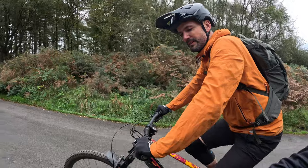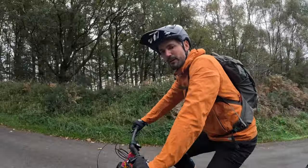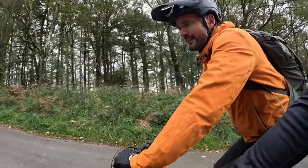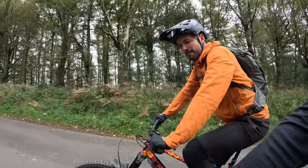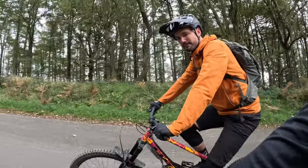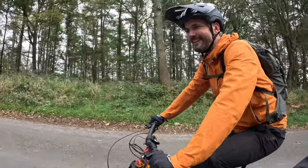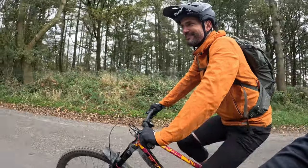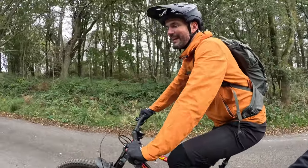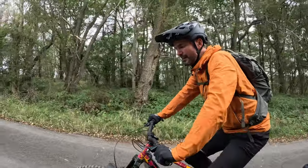That's the stock setting, but we can still do our mullet setup the way we do on the other bikes by putting an angle set in to sort out the head angle. Lift the BB up a little bit to make sure that works. Or just pop it in and slam and slack it. Well, you could do. That's a... Yeah, he's frowning now. That's a little bit less of a thing now, I've dropped the BB. But no, you could slam and slack it, definitely. But we have got a mullet option.